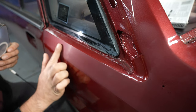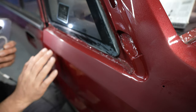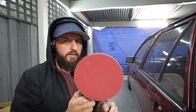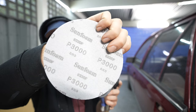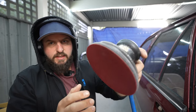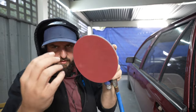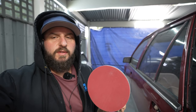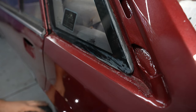Just a little bit of an imperfection there. It depends how picky you are — you can spend your whole life doing your paint job. I'm not really going for a show car job, just don't want it to look completely crap. Another method you can use is these 3000 grit pads, which I got from Paintway in Sunshine, Victoria. It does have what's called an interface pad — see this little spongy part — so it doesn't dig in too hard. I do have 3000 paper you can use on a block, but this pad will make it faster. This you use dry, without water.